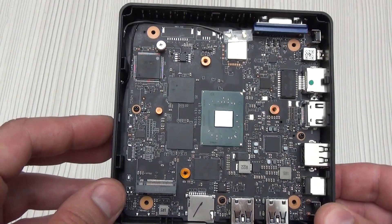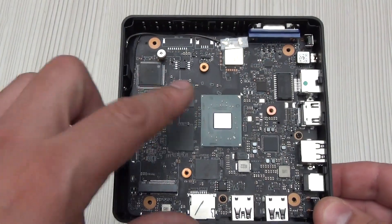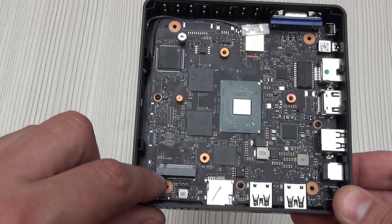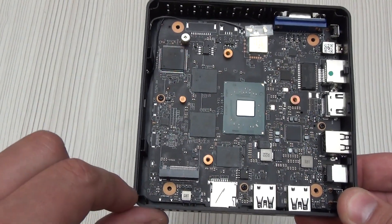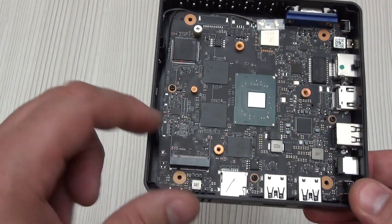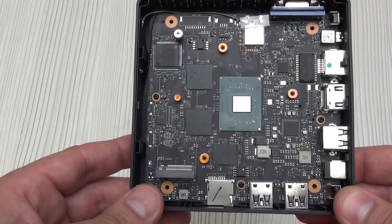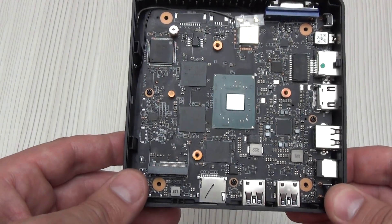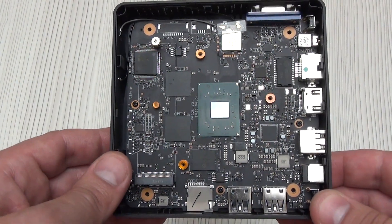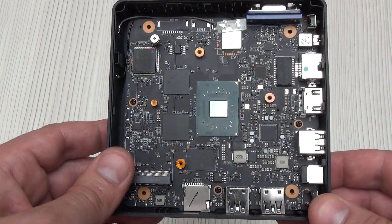To the right are two RAM modules — SEC532K3R6363 — LPDDR4 memory with a capacity of 3GB each and a speed of 3200 Mbps. Behind the M.2 memory module port is a 3-pin connector whose purpose I have not determined — perhaps for connecting a cooler; write in the comments if you know. To the right is the built-in eMMC memory chip UEMC GS03-S0A, 64GB from Udstore. According to the datasheet, the maximum read speed is up to 300 MB/s and write speed up to 110 MB/s.